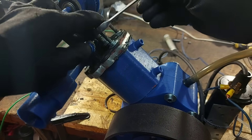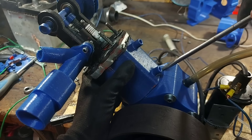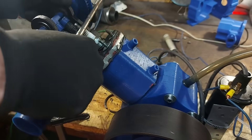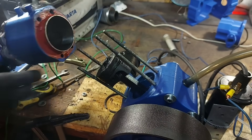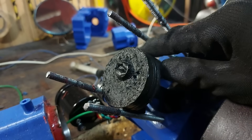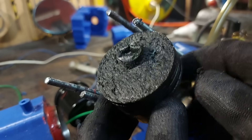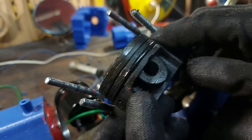Let's go further inside the engine to see all the damage. The top part of the piston was completely destroyed. I'm thinking all the goo we saw before was carbon fiber reinforced nylon being ejected through the exhaust port. That blob is a bit off-center, which is the exact location of the spark plug.